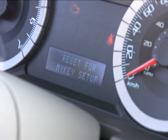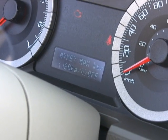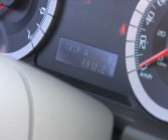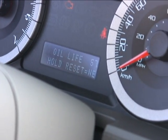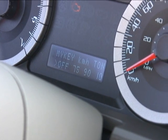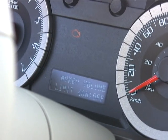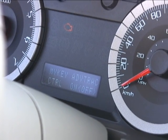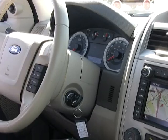What MyKey does is limit certain parameters on the vehicle. I can go into a setup menu for MyKey and limit the maximum speed to 130 kilometres an hour — the demo software shows 120, but the production software will be 130. I can also set a speed chime at either 75, 90, or 105 kilometres, limit the radio volume, and set it so safety features like AdvanceTrac cannot be turned off by the driver. So now we've created a MyKey.